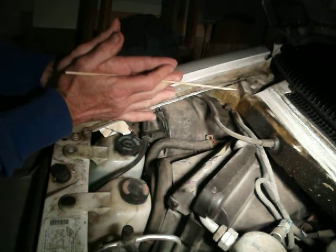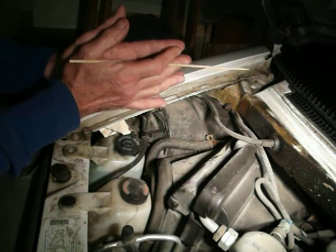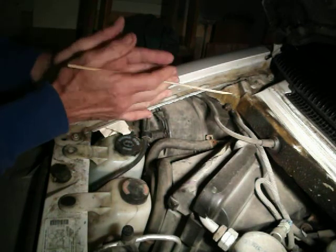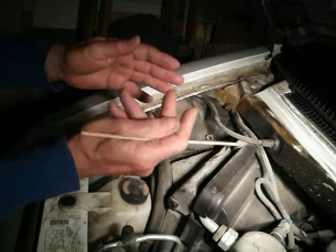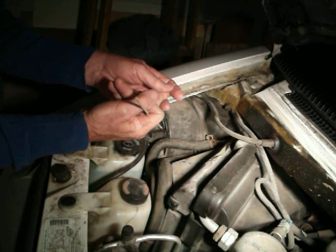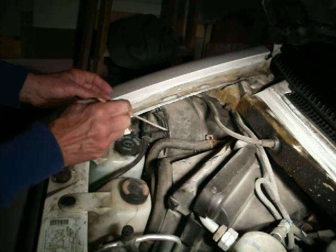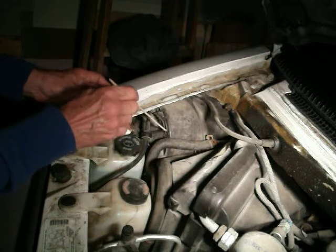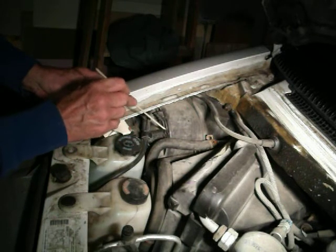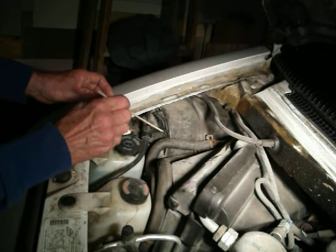When you look to see the way they put the motor housing together, it looks like they've spot welded 2 halves of 2 pots together. If you look closely on this one, they weren't spot welded at all. They had little tabs on one, went through holes on the other one, and they just folded them over. It was easy to take apart. In the end, I got this thing completely fixed without ever taking the squirrel cage off. The squirrel cage, I don't know how you get it off. I tried very hard and it wouldn't budge for me.